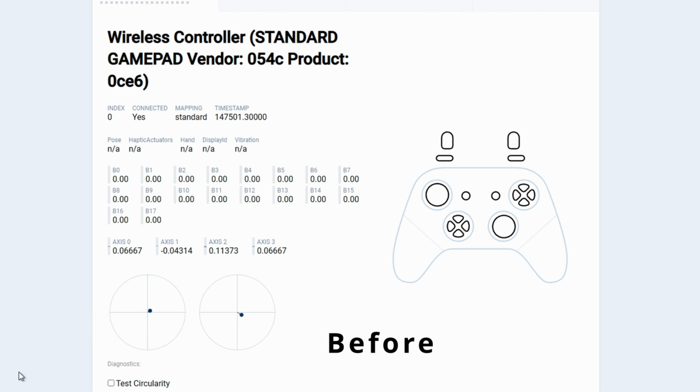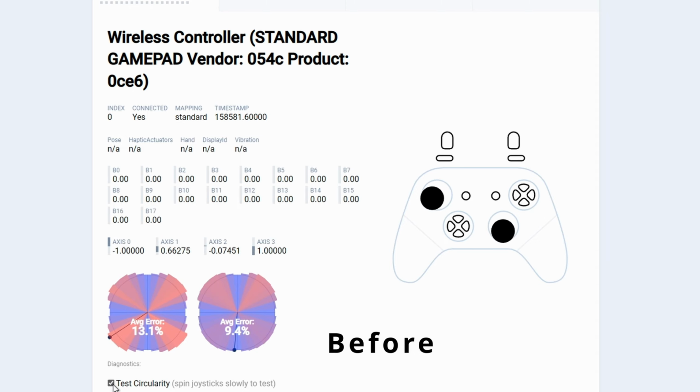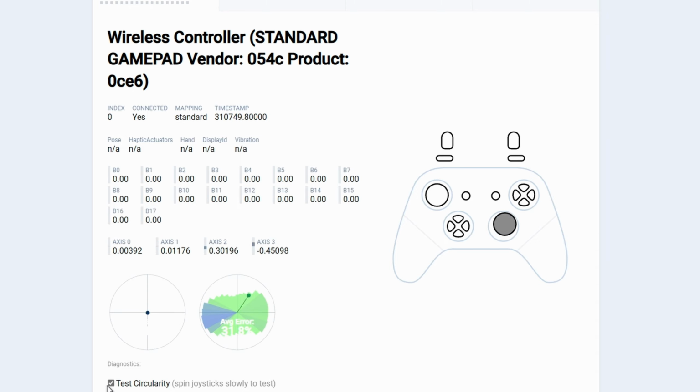From here, you can see that the active area is actually distorted and reduced. Another issue is if you want to make adjustments, you still need to open the controller shell. Along the way, I broke my trigger for the controller and shorted the motherboard. The DualSense motherboard has many tiny components that are smaller than half a millimeter, and knocking one of those can render the whole motherboard a brick. I need a new controller because I still need to push the video out.